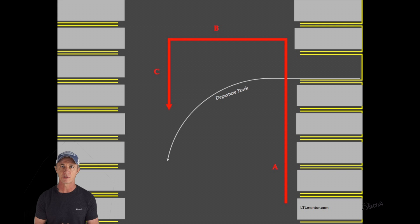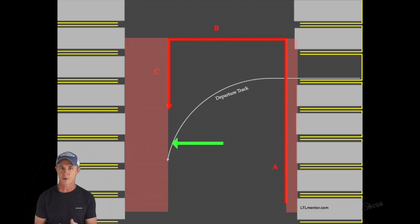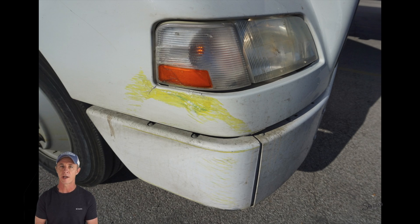It's also the shape I trace out when making a U-turn. Unlike leg A, which runs close to the spaces along the passenger side, leg C is further away on this side. This cushion of space is critical. When I turn the steering wheel sharply to follow the trailer, my front end will swing outwards. Clipping the front bumper on the passenger side is a common accident with new truck drivers.